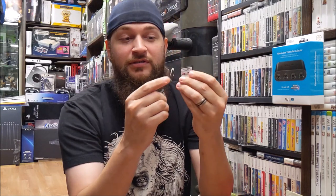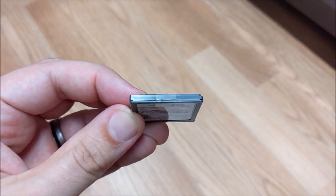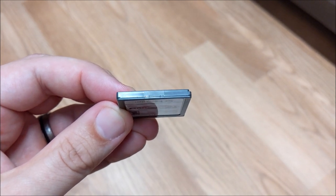I have a real copy of Mario Kart on the DS and a fake copy of Pokemon Heart Gold, and the way that you can always tell if you have a real or fake DS game is looking at the top side of the cart. So here's the front, right along the top side. On real ones there will be little indentions in them, on fake copies it will be smooth. I'm going to zoom in now so you can see the difference between the two. On the real DS cart you can see along the top edge, right in the middle, that there are multiple rectangle shaped indentations, both in the front and back half of the cartridge.